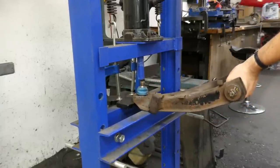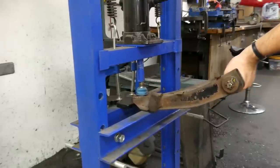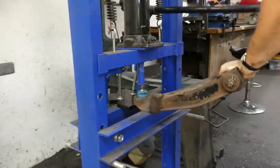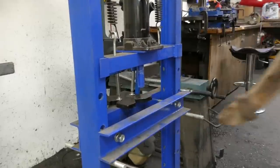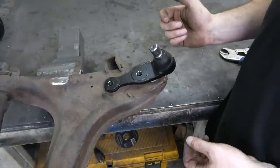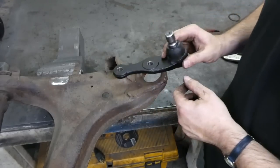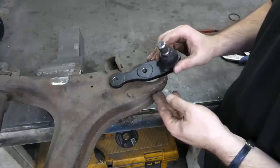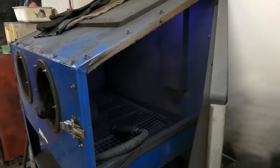Now this ball joint should pop right out. It's not like it's been subject to roads. My plan is actually quite simple. Switch to FC RX-7 ball joints, which bolt to the control arm. I'll fab a plate that is slotted, allowing the ball joint to be adjusted in and out so everything can be dialed into place on this essentially prototype suspension.